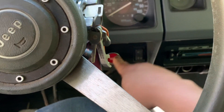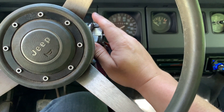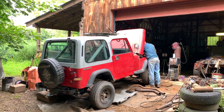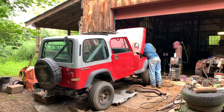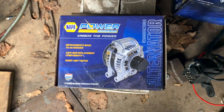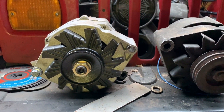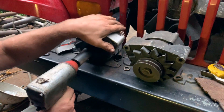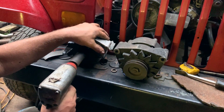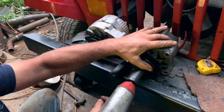All that just simply translates to this. That footage was from the original build last year, and now I bring us up to date to the end of August in some record heat, where we continue to modify and simplify the Jeep. Instead of using the expensive Mercedes alternator, we are going to adapt it to the GM one-wire. It does continue to surprise both me and Kirk just how many GM-compatible parts are on this OM617, and if they are not compatible, they are certainly very close. The alternator is not much of an exception. We are going to swap the fan and the pulleys, make a bracket, and this alternator will work.